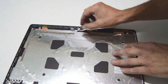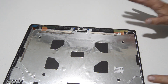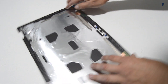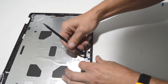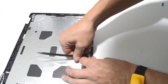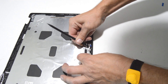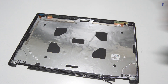The only thing left is the webcam and the Wi-Fi antennas. We're going to go ahead and leave the antennas in here, but they're all just kind of stuck in. For the webcam, it's a lot easier not to damage it if you get it from the bottom or the top and not the sides. They're very thin so it's really easy to damage them if you're prying the wrong way. Just get a nice flat edge and peel it up from the sticky tape. And there's your webcam.